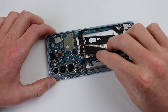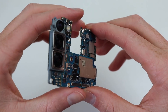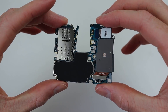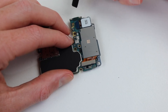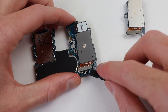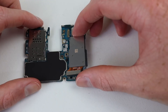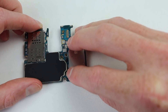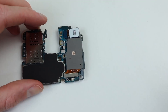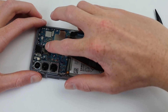With limited room inside the phone, I found the best spot to pry was in the lower left-hand corner. Once the board had been removed, we can take a closer look at it, and around back you'll see how the cameras are attached. I'll need to disconnect those and swap them between the two devices to simulate a camera repair. In doing this, we're going to see whether the rumour is true and whether the cameras are or aren't replaceable in the S20 phones. With the old cameras out of the way, I'm going to swap them across and reconnect them. I found these a little bit tedious to connect and required a little bit of patience to get properly seated.